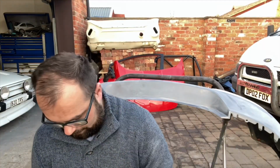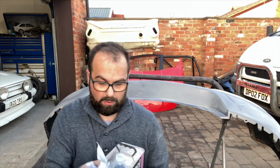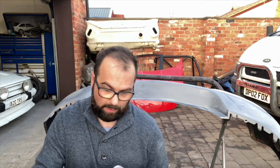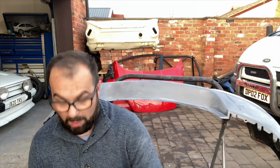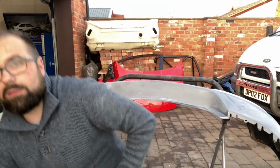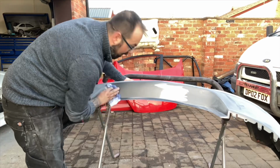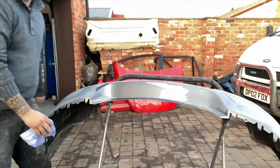What this does, guys, panel wipe, is if you've done any body work, and obviously when it's sanded it's pretty much matte. If you use panel wipe on a cloth and wipe it, for those few seconds while it's wet before it evaporates, because panel wipe is just basically really mild solvent, it takes any impurities, just make sure you get no reactions. You can get a general idea of what it's going to look like because it fetches the shine back. You see that?